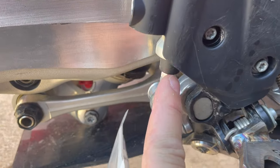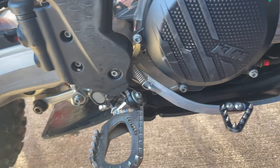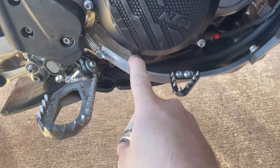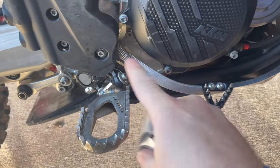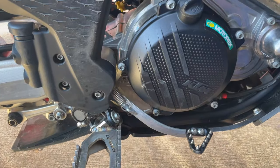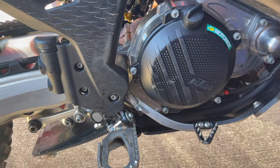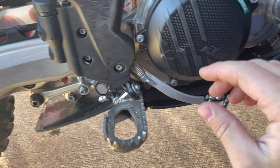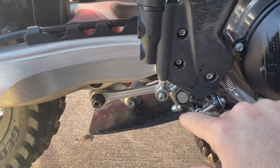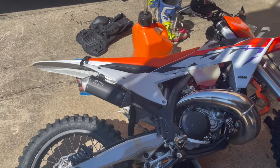This sweet little piece goes right in here and gets rid of that. By rights you can get rid of your spring on top of it too. I have to take this apart - I'm going to change my oil while I'm at it because this has got to come off anyway. Screw it, we're changing the oil and throwing the clutch weight traction disc assembly and the S3 brake spring on it.